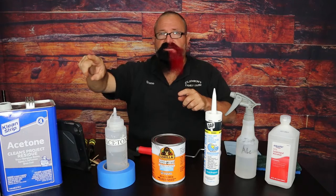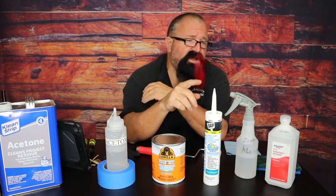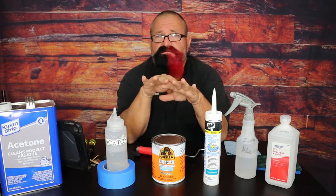The acetone will do the same thing, but I think the alcohol does better for water displacement. If you've got a little crack or crevice that has water in it, use the alcohol, spray it in that crack. It will displace the water out — dry it with a towel and give it about 10 minutes and the alcohol has evaporated and gone, so you've got a dry surface to work with. I also carry a can of compressed air for dusting off computers — that works too. Between the can of air, some towels, and the alcohol, you'll get all the surfaces dry.